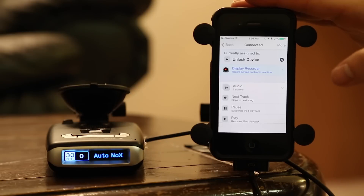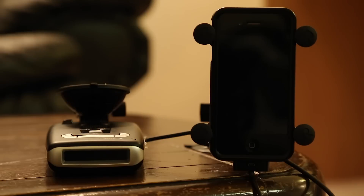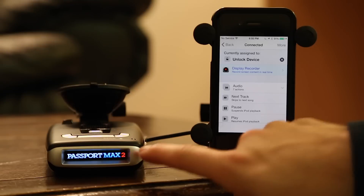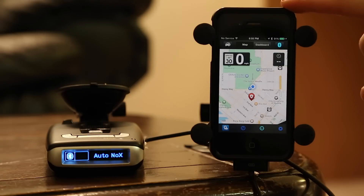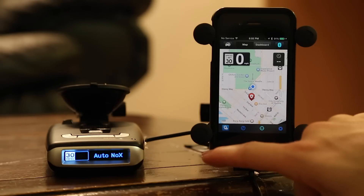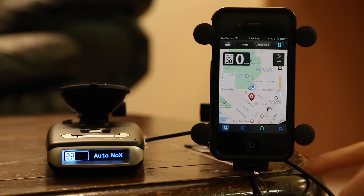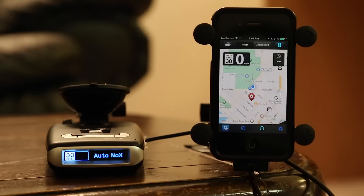So what you can do is: when the phone receives power, we're going to unlock the device — that'll bring it up to the main screen. Step one is going to unlock the phone. Then there's a time delay while the detector is actually booting up. A couple seconds pass, the phone is already unlocked, the Bluetooth connection is made, and now that the phone is successfully unlocked, it can go ahead and launch the app for us. If we don't have that time delay and we try to launch the app while the phone is still locked simultaneously, it's not going to work. So you do need to first unlock with the power, then the second step is the Bluetooth connection launches Escort Live.